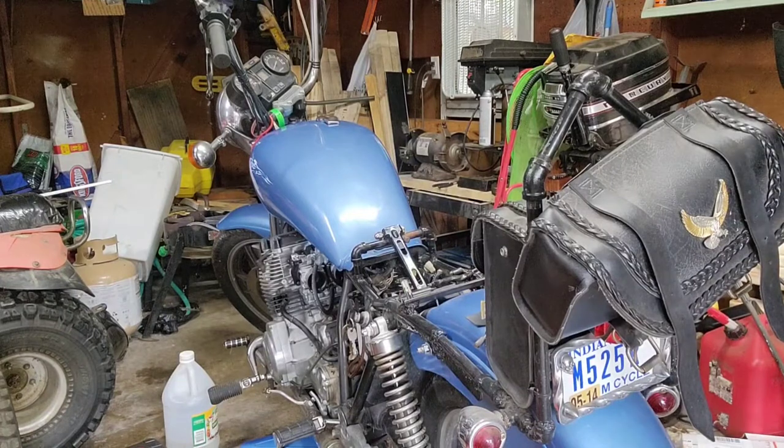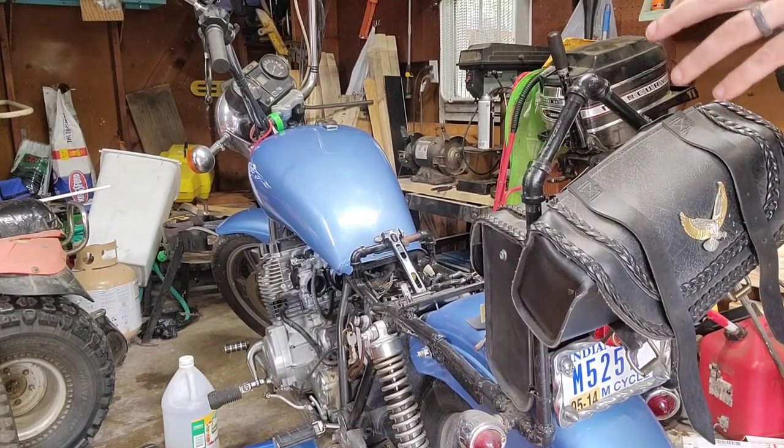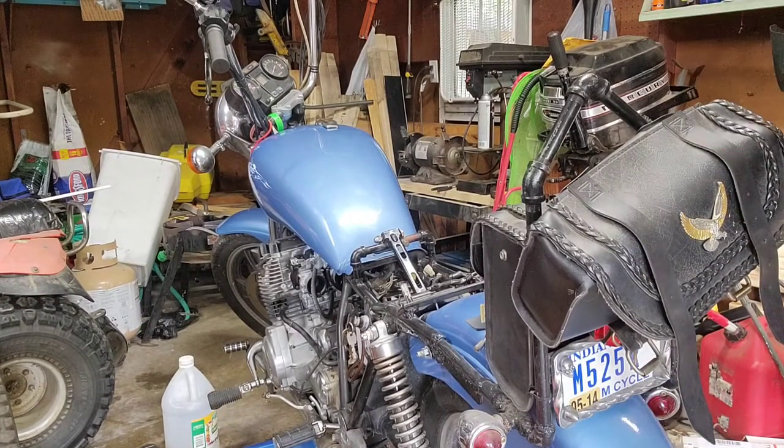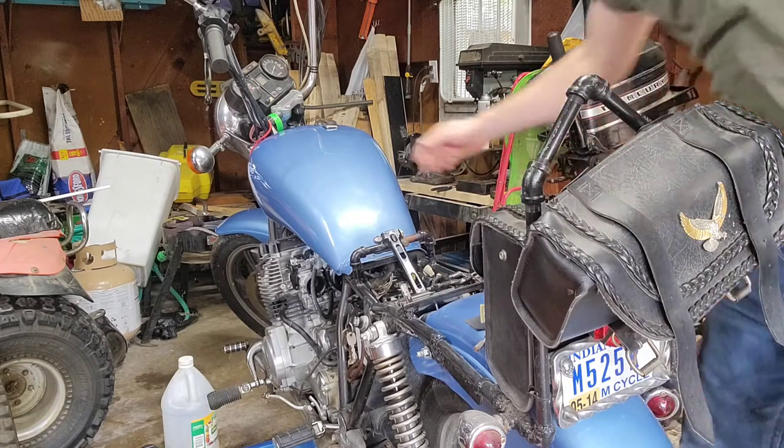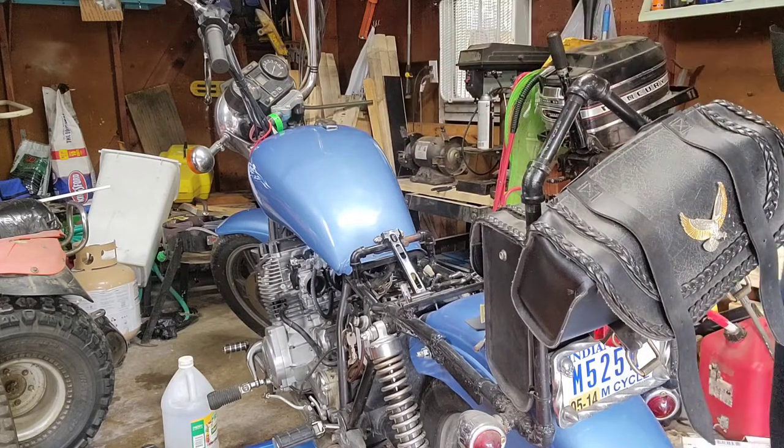All right, so gas tank is fitted. It is 100% on, not bolted down, but it's not going to go anywhere. I haven't turned the fuel on to the carbs yet. So I got the accelerator pump adjusted. Sat there for a little bit, back and forth on that. Pretty simple. It's just two screws. There's one that sets when it starts and then one that stops for the travel. Pretty simple stuff. So got the fuel lines on.